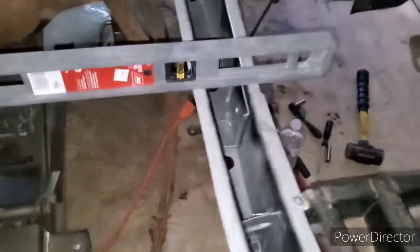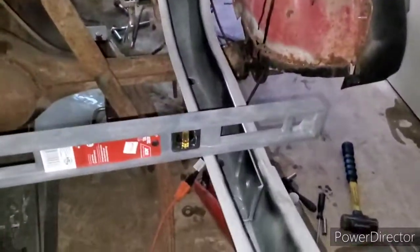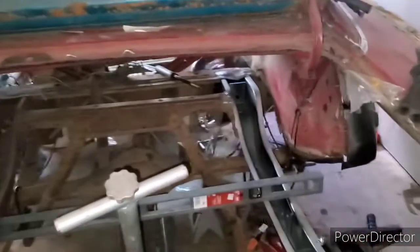That's why mine was screwed up. I did my driveway and that was very unlevel. So here it is. It's a little time consuming to make sure that the frame rail fits. See, it's kind of flimsy. It's because it doesn't have the shackle, but these things are pretty flimsy anyway. But what makes it strong is once you put the floor pan on, because you know unibodies, once everything ties together, that's where it gets its rigidity from.